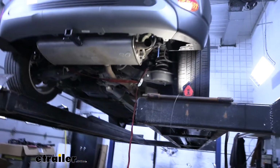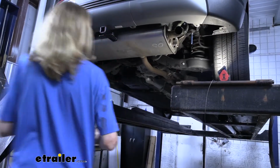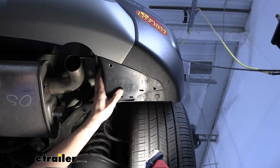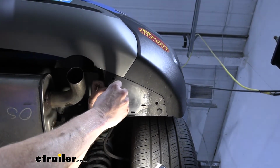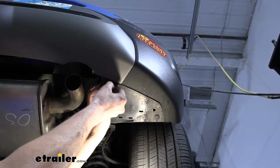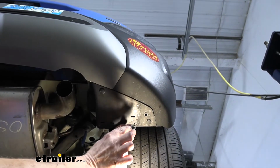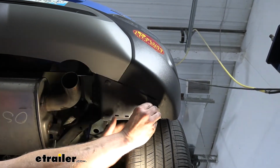After that, we'll get our tools and our strap out of the way there, and then we can reinstall our paneling that we had removed there. It'll just slide up on there. Take that little lip up in there just like that. Our push pins just simply insert into there. Kind of got to squeeze the ends, so if you spin it a little bit, you can usually get them to squeeze together so that way all four of the little prongs line up. If you pull the head out some, they'll squeeze closer together to make it easier to insert.